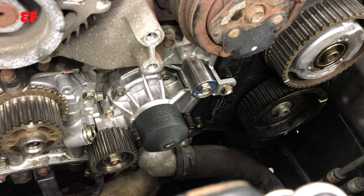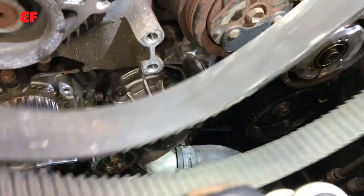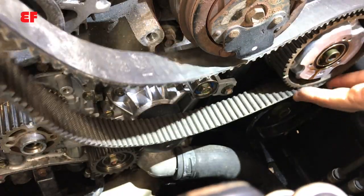The problem with this bolt is it's got 70 foot-pounds of torque on it, but the breaking torque to loosen it is probably over a hundred. There's no thread locker on it, but it's a super sticky bolt. A lot of people end up using an impact and they strip it or break it — all kinds of bad things happen just trying to put a seal in, and you can basically ruin the whole motor.